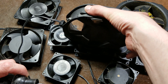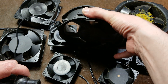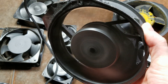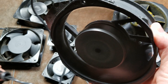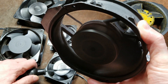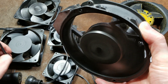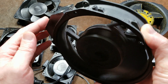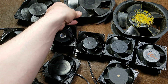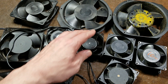Just to give you an idea how much noise even a big 172 by 150 millimeter fan will make — let's see if I can get this held. So one like this might move 100 CFM. As we can hear, it was not tremendously loud. Let me slow that down — kind of like a bathroom fan, only this would be twice as much airflow.